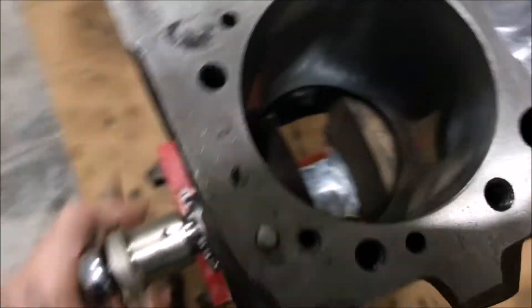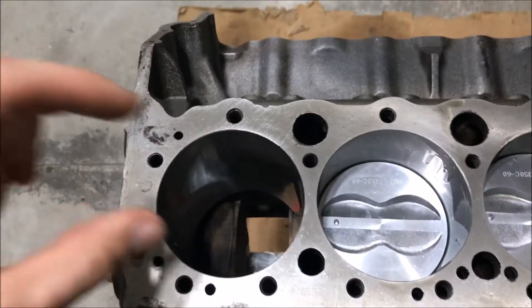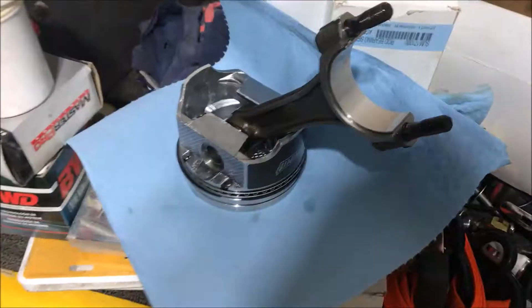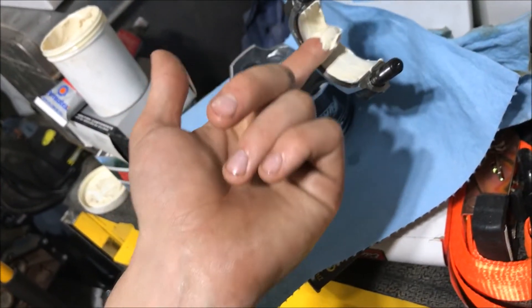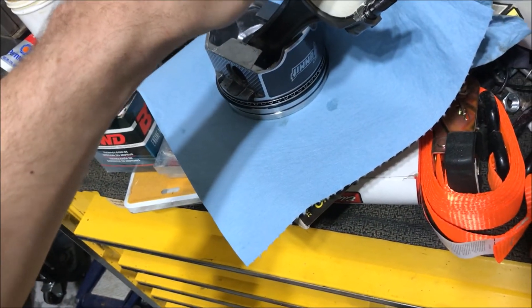So that's where I put it. The reason you do that is when you put the piston in at the top of the bore, your rod isn't actually going onto the shaft yet — you want to carefully be guiding it down as you do that. I got my piston out, got my cap off. I know I already applied assembly lube to the crank, but I'm just being extra cautious — just a thin layer on the rod bearing, just like that, covers everything. And here — this is a piece of 3/8 inch hose — stick this right over the rod bolts.